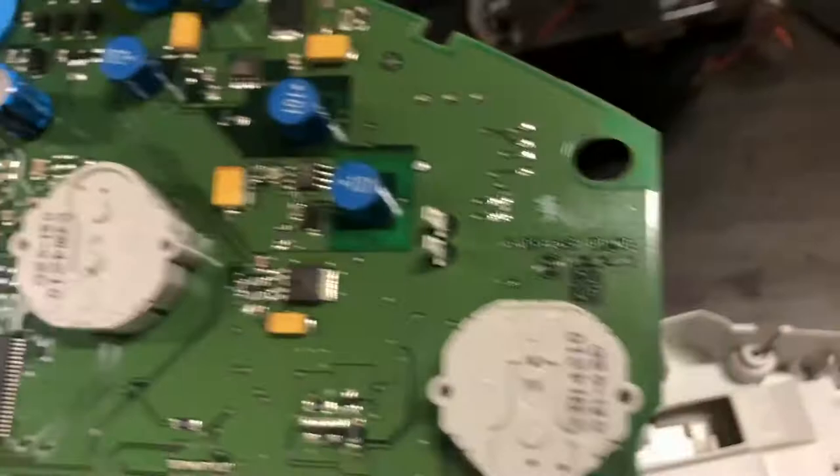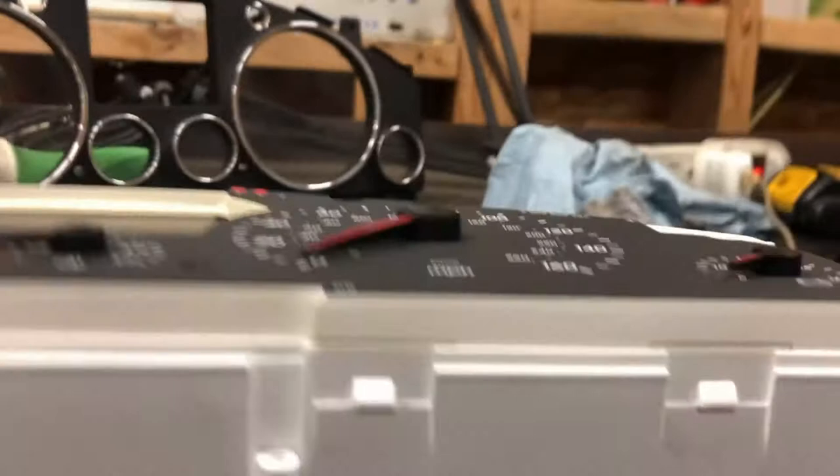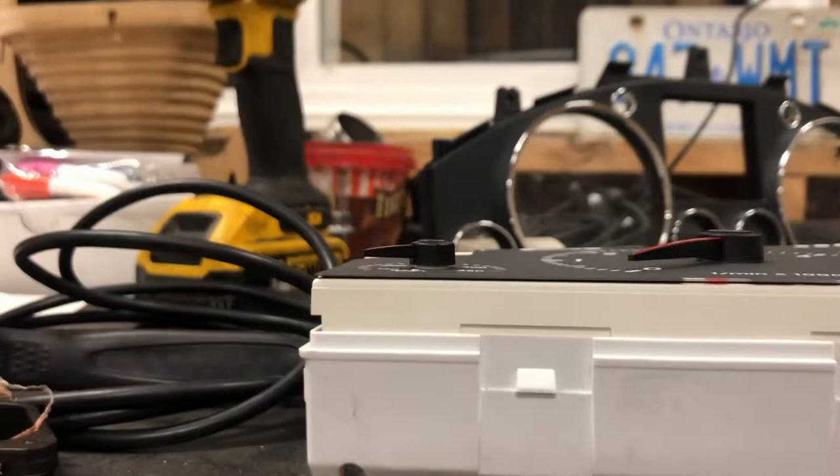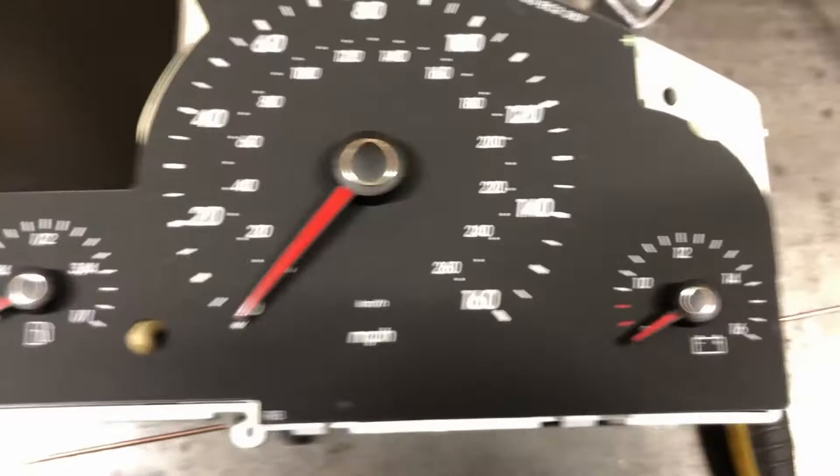As far as the needles, make sure they all have a nice gap and that when they hit the bottom they're at their at-rest state. If a needle goes too far one way or the other, you can just tweak it down to the stop and then just a hair past. Bolt it all together and you're good to go. Thanks for watching — hopefully this helps.